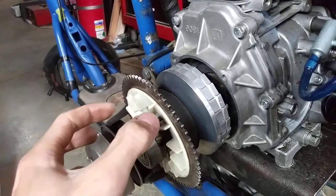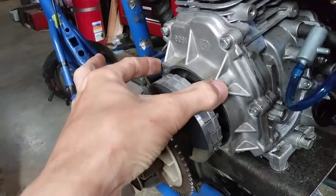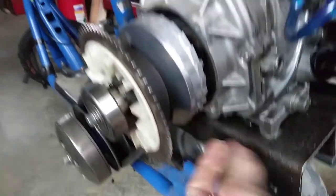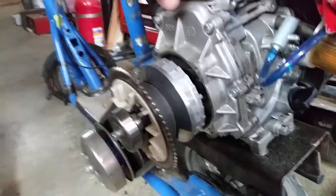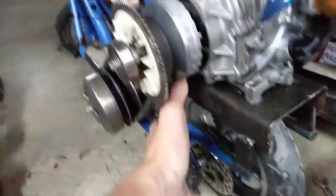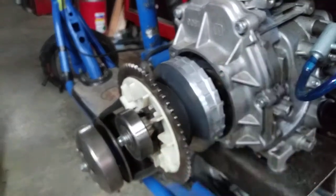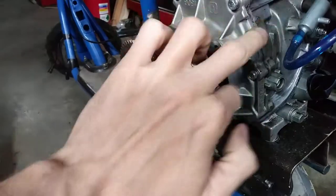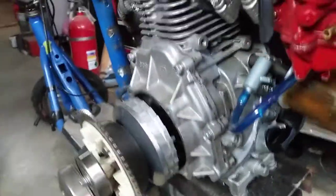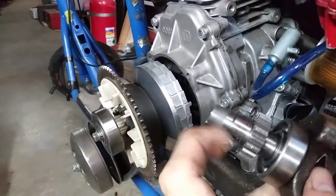It's going to have a pipe here, and it's going to have steel come out like this and go over and bolt to this. There are four bolts down here — these were the original engine mount bolts when this was a friction drive scooter. The engine was flipped and mounted to the side approximately like right here, and these bolts go right in there quite a bit. So this extra support right here will take a lot of strain off of the bearing in there. This is in there about like that, so that's a lot of leverage on this poor bearing.